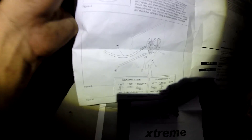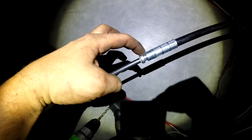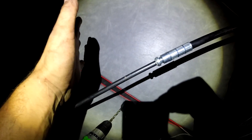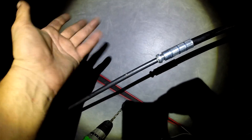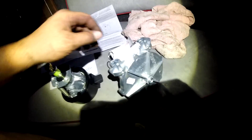What's got me a little worried — the instructions are saying to have your steering wheel upside down and wind it around until the cable comes in on the top one. There's a spring-loaded mechanism in here that clicks onto the end of this, and supposedly when you do that the center steering wheel will be centered and straight. I'm taking a chance here.